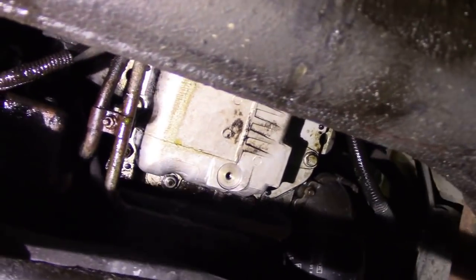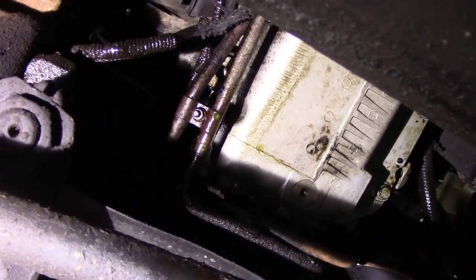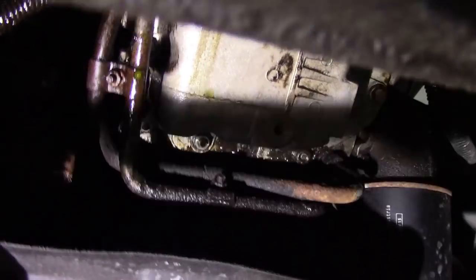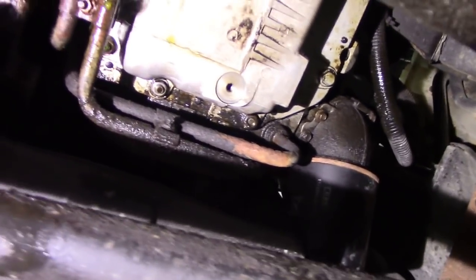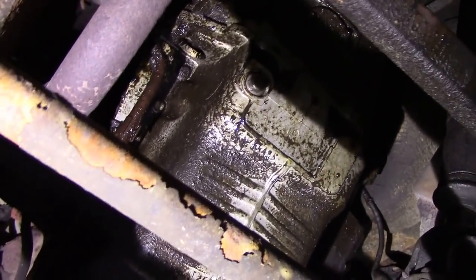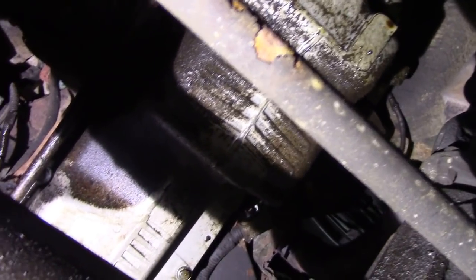Now with the regular light on you can see quite clearly that what's fluorescing is actually antifreeze or coolant — I didn't put any dye in there. Around the front of the crank, although it's oily, it wasn't actively leaking out of there. You can see where it was leaking in the past, but I got underneath quickly with a steam cleaner and washed it all off. I replaced the crank seal anyway and we haven't done that many miles. You can see where oil has been spraying on the back from the old leak, but if that was new oil leaking it would be all green and glowing — and it isn't, so that's a good sign.